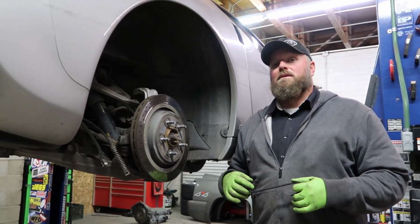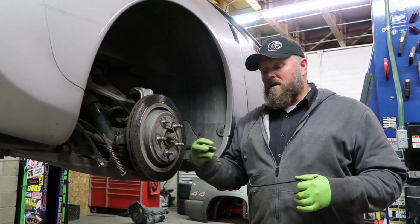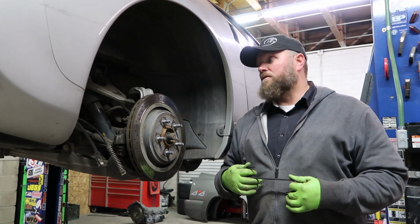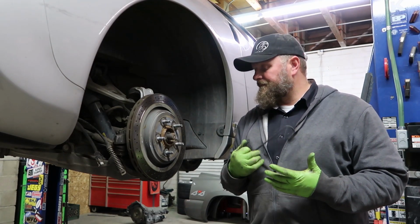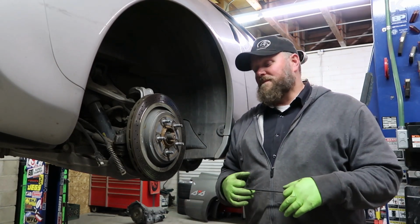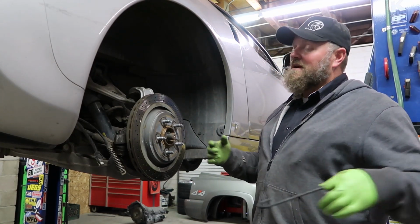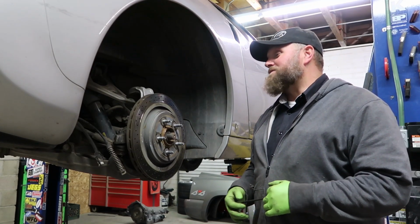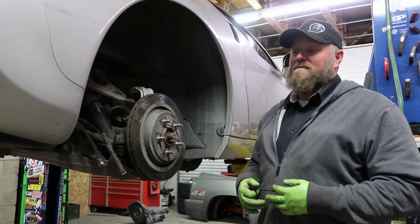Mm-hmm. And the trunnion bearings are on the rocker arms. Hey, what is a trunnion again, man? It's the bearing that's on the rocker arms. Right? Oh, okay, yeah. On top of the heads. And so they had failed and ended up in the oil pan. And he's like, hey man, the car doesn't have any oil pressure and the check engine light is on. All right. So sure enough, brought the car out here.